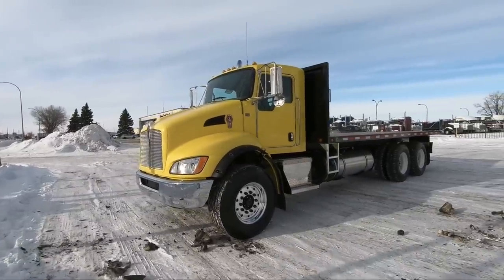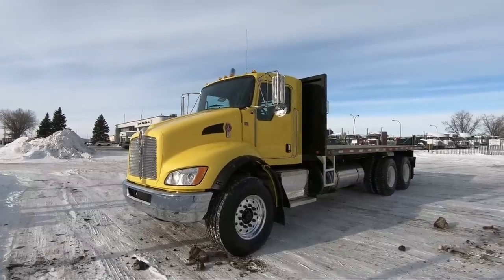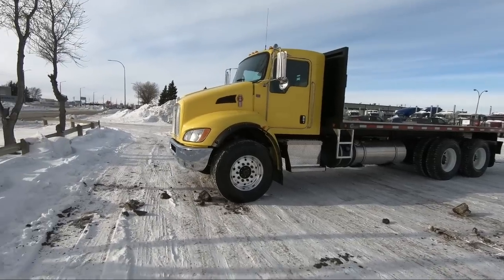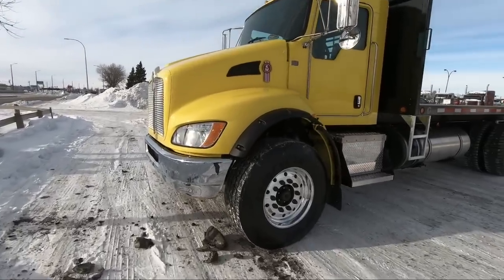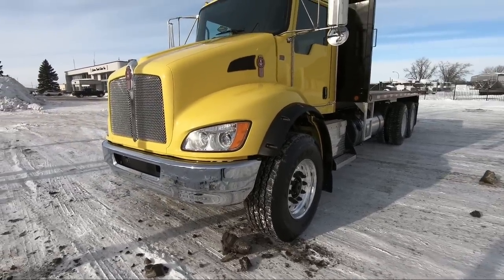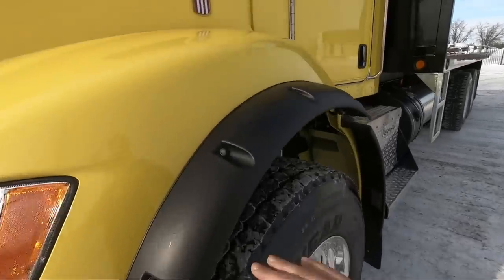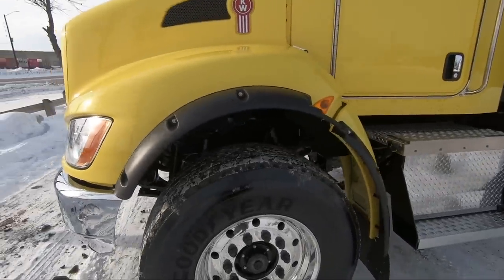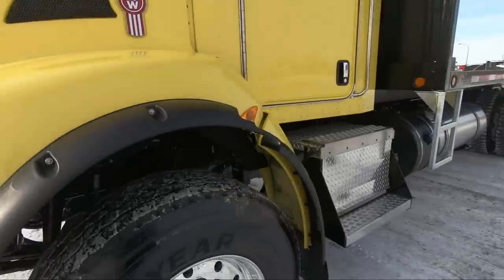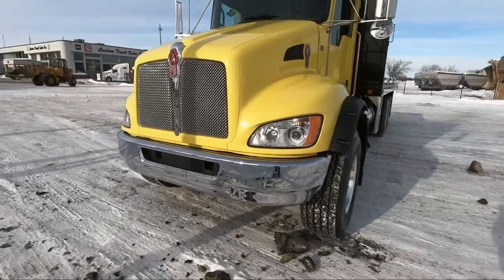All right, so here we are at the truck. Here is a 2020 model year Kenworth T370. This is a real special truck to me. I love the fact that we can now do the big 385 wide base steer tires on this truck. I built several trucks like this before it was even offered at the factory as prototypes, and I'm glad to see that the factory is now doing it right on the factory floor. We're putting on these fender lips because the tires stick out a little bit beyond the standard fenders, just to keep the road spray down. It looks real sharp with this aluminum stainless steel bumper.